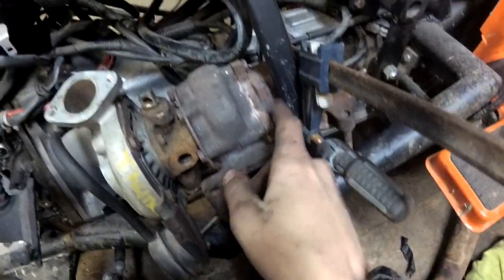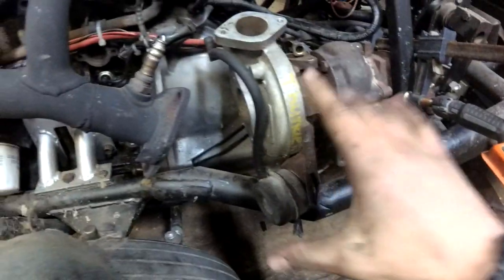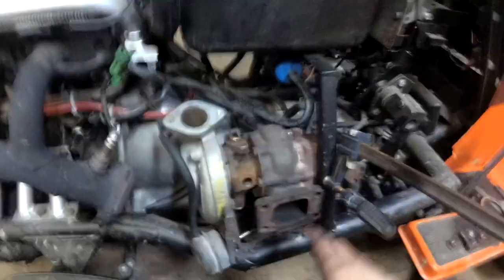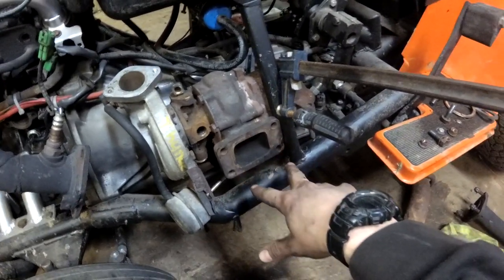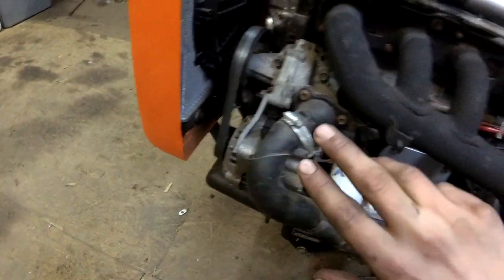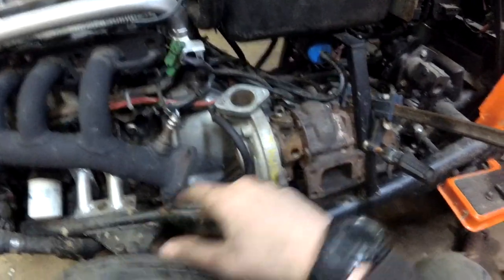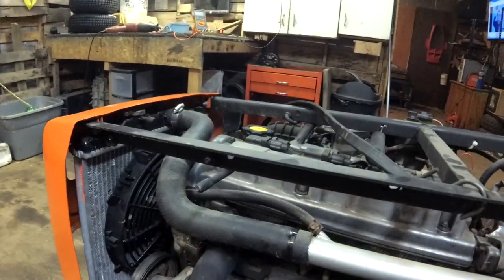This was the downpipe. I don't want to have to make something new for this because it's a nice two-bolt simple flange — much easier than trying to bolt onto the turbo outlet. I can't really clock these individually however I want because I'm keeping the internal wastegate. I don't want to spend another 50 bucks on an external wastegate. The inlet being here means we need a pretty generous radius there to not kill flow. It's going to stick out a little, but not much more than the alternator. I think I'll just have the side panel have a cutout for just the pipe. That will give me a path for the charge pipe up and over to the other corner.